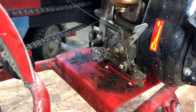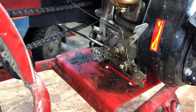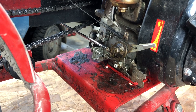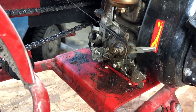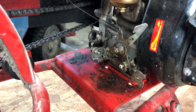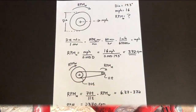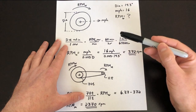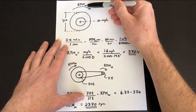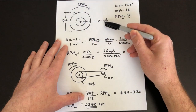Once the engine speed drops below 3,600 RPM it allows the throttle to open back up, and it does that repeatedly — that's basically how it governs top speed. When I give it full throttle, it pulls this lever back, activating by a spring the governor linkage. If you want to increase or decrease the top speed of the bike, there's an adjustment screw back here — basically the linkage butts up against it. If you want to go faster, you can unscrew it with a Phillips head screwdriver, and it allows the throttle to travel further and further back, letting the motor rev higher.